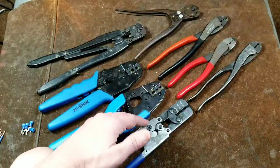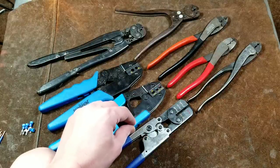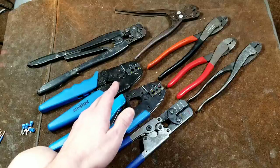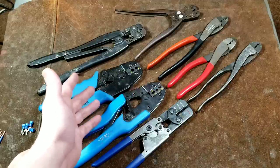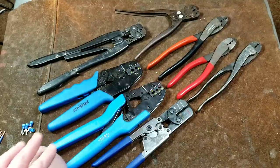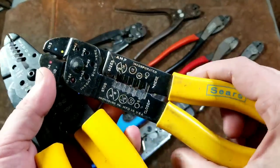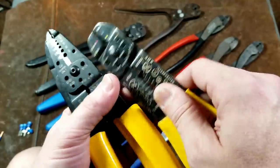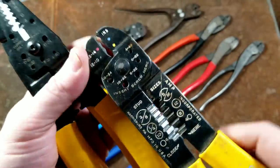In any normal work — whether on cars or anything else — if you're working on terminals smaller than 22 gauge or large battery cables, you need a different style of crimper. There are hydraulic wire crimpers from Harbor Freight for large scale work, bolt cutter style, or compact heavy duty ratcheting ones, but this style covers the most common wire terminals. Most people when they get kits receive a set of crimpers that look like plate steel ones. High quality ones like these AMPs are thick high quality steel, but most kit crimpers are terrible — you can just grab and fold them.